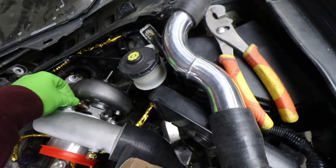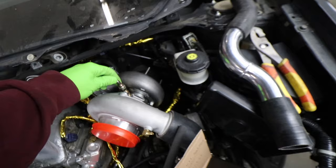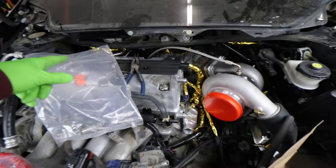We're going to get that threaded onto the turbo, and then the oil line that comes with the CX Racing kit — I've heard people say it sucks and leaks — but we're going to try it out. It's going to thread right onto there, run underneath our ignition coil cover and come right out to the back of the block by the oil pressure switch. I'm not sure what the thread pitch is on the oil pressure switch, but we are going to get a two or three-T adapter fitting that threads into the block, and then we can thread our oil feed line, the oil pressure switch, and possibly an oil temp sensor onto it.